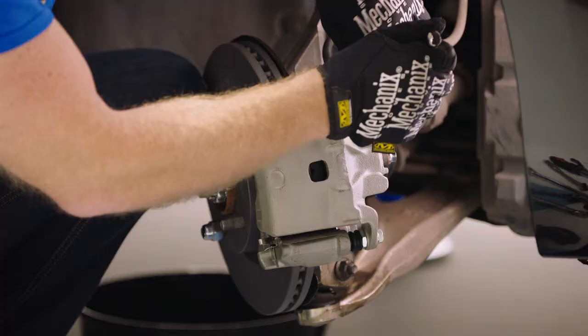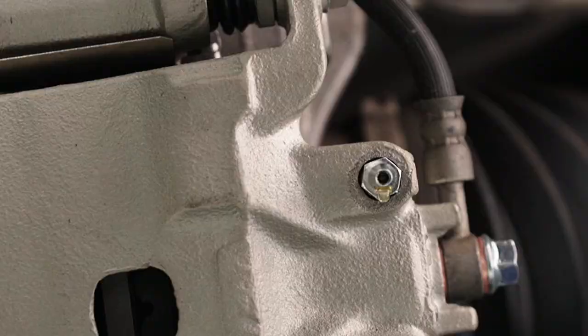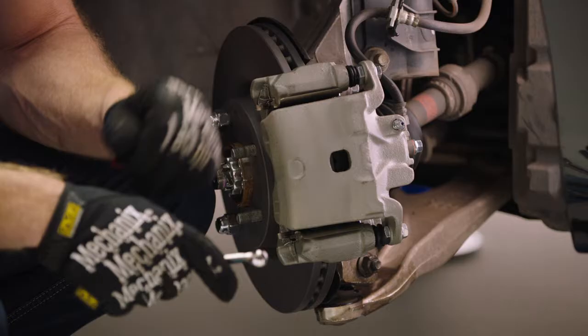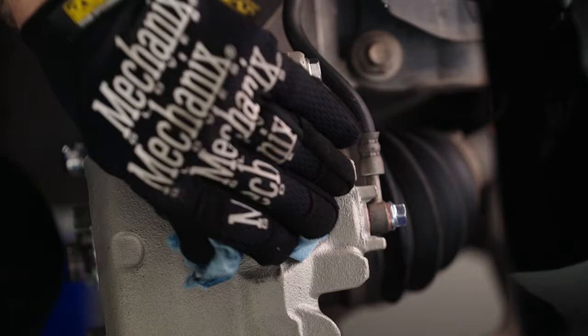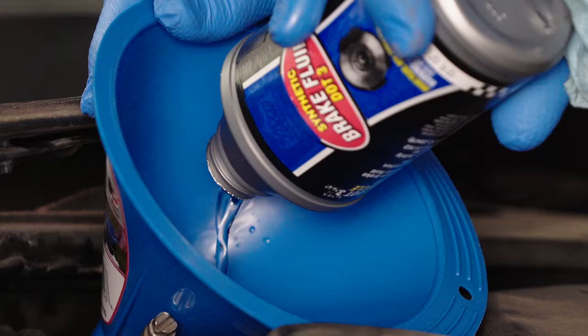Next, go ahead and top off the master cylinder with some brake fluid until it's at the fill line. Next, we have to gravity bleed the brake system. Let's locate the banjo bolt — look above it and you'll see the bleeder valve. To gravity bleed, just open the valve using a box end wrench. The brake fluid will fill the caliper which runs down from the master cylinder. Once the valve leaks, we'll close it up and bleed it. Once it bleeds, we'll close it off and wipe off any residual brake fluid. Open your brake fluid reservoir and fill it back up with brake fluid to the fill line. For a step-by-step overview of bleeding the brakes, see the video at GoodyearBrakes.com.